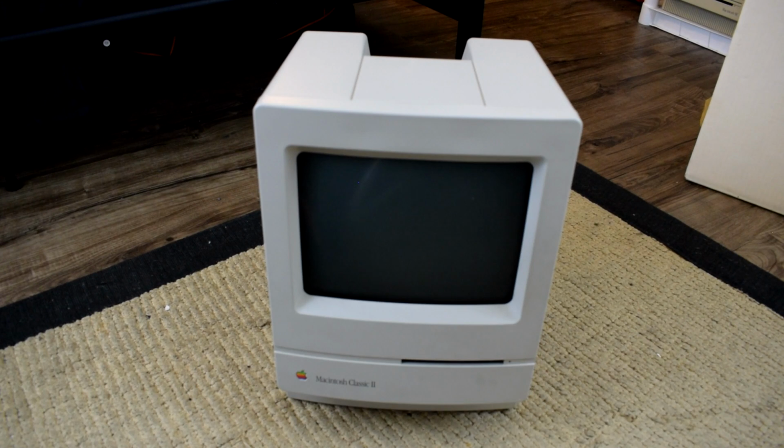And I had a problem with powering some of those on. And these machines have fans in them. The original Macintosh Plus, I don't believe it had any fans in them whatsoever. These do, and because they're running at higher clock rates, I'm assuming they need the fans. I'm a little worried to try and power this on. I don't have a Variac. I don't even know if that would help. But I'm afraid that if I flip this switch, I'm going to have to chuck this in the send to Akiba pile for him to do a full recap of the power supply or whatever the hell's needed. And that could be where all my Macintosh SEs are going to be properly repaired. Let's actually try and turn this on.